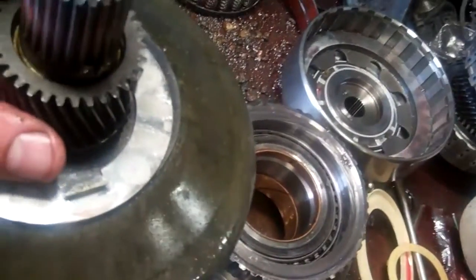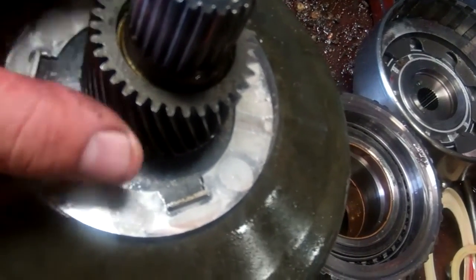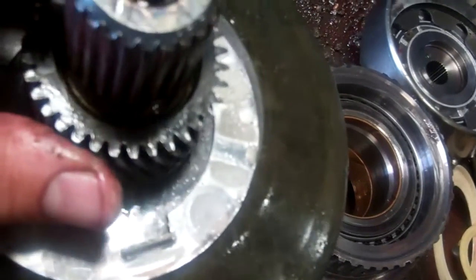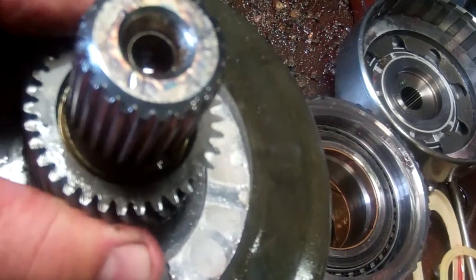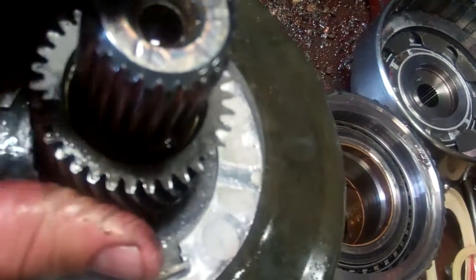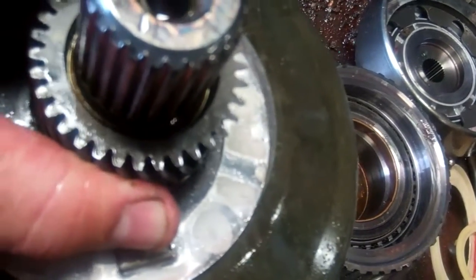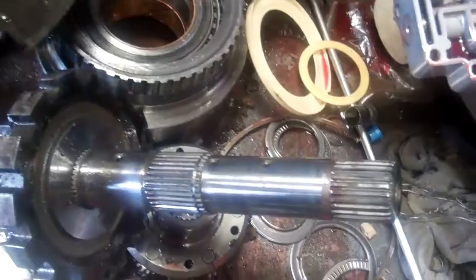We also have some significant wear in the bushings. So down inside this sun gear, there's a bushing there and one on the other side. I flipped it over because it's a little easier to see the play, but basically this piece here we can wiggle. And if you look down along the shaft here, right down in that edge, you would see the wear from the bushing, which is quite common. So the bushings themselves help support everything in the center line. There's the front one there, and the rear one is there. So the bushing is going to have to be replaced as well. That's just a wear item.